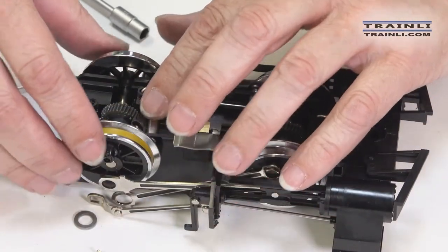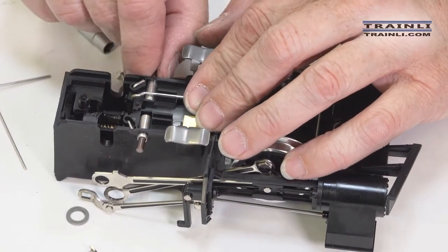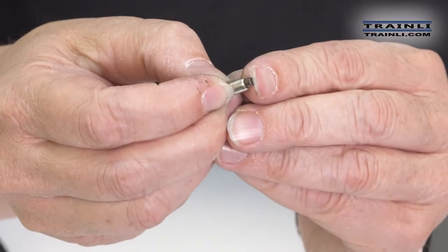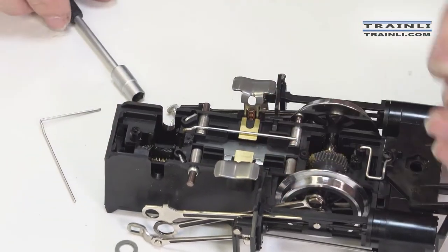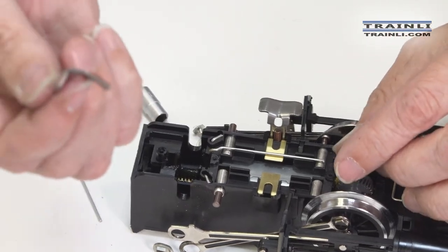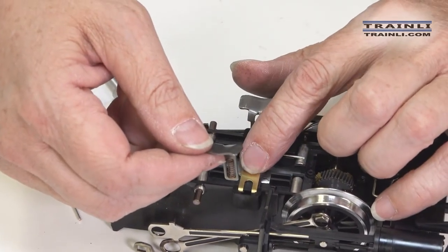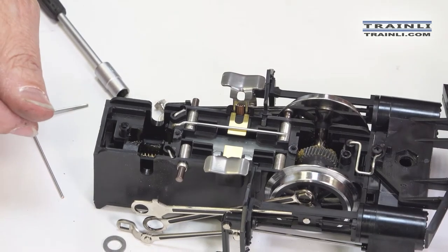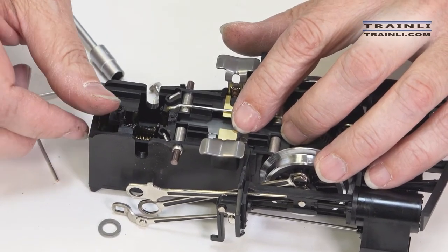To replace the wheel, it's quite literally that simple — the brushes just pull out. If the brush is very short like that, you want to replace it; but if it looks something like this it should be fine and may just need a little cleaning. The shoes are usually pretty simple to change out as well — they just sit into their spots and make contact with this little metal plate. Sometimes the shoes get stuck, and unfortunately when they do you essentially have to destroy the shoe pulling it out using a pair of pliers or something like that.